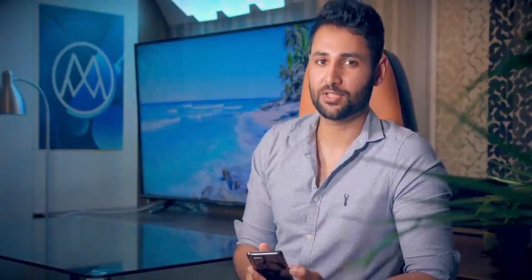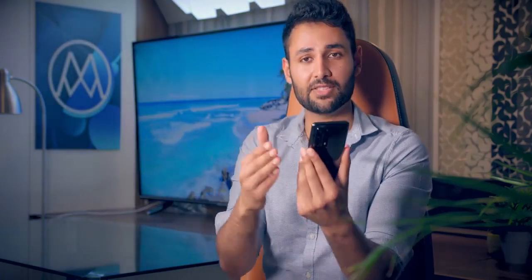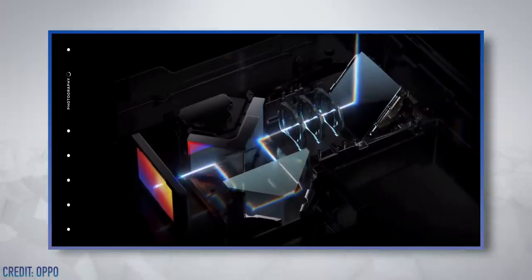It is seriously cool, and some phones in the past have used this to achieve up to 5x optical magnification. But to hit the 10x scene here, you've got to create more distance. You've got to create the longest possible pathway for that light to travel between the lens and the sensor. So, just for this phone, by the looks of it, maybe they'll use it in future ones too, Huawei's created a completely new system that bends the path of the light 5x within the body of the phone.